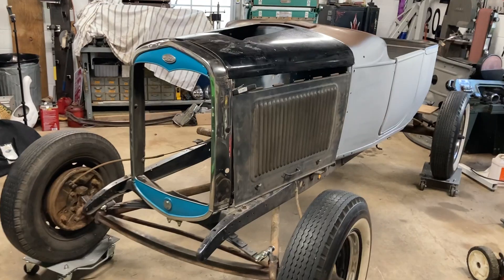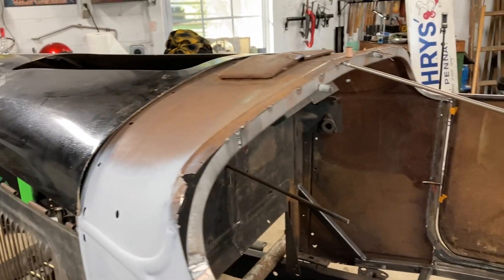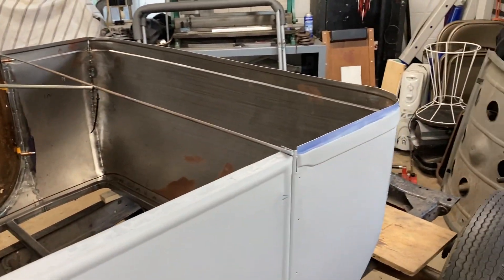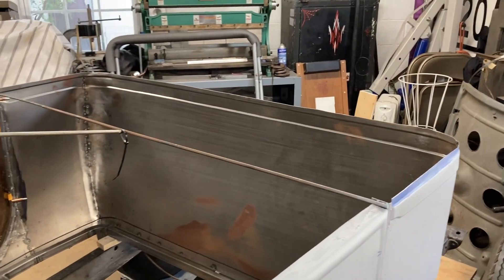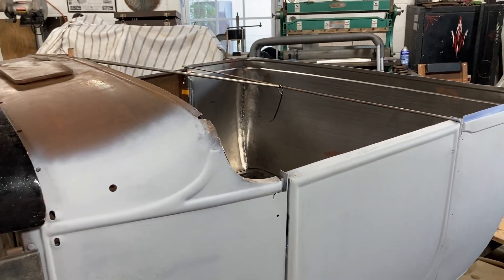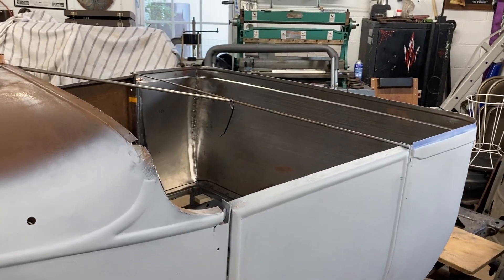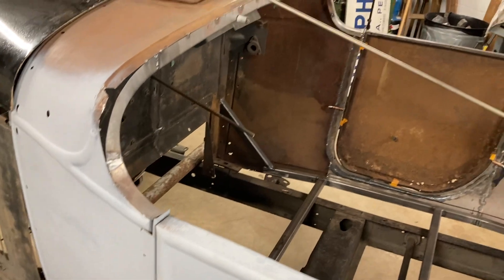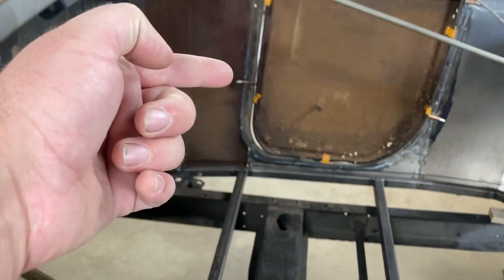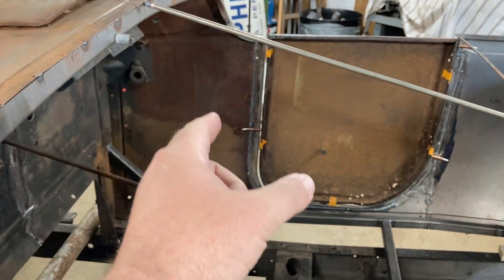It's making sense. I think the next step is to purchase some steel to finish out the back section — much like I did the dash rail up here on the cowl, I want to do a finished area on the top of the back section of the body. I thought about doing a duck tail like you'd see on a T-roadster, but it might be a little too exaggerated for this kind of shaped body. We're going to have a slight arch from left to right but nothing too dramatic. Once I'm satisfied with the A-pillars on the outside of the body, I can go ahead and start the inner structure for the A-pillars — one-inch box tubing continuing up to the connection between the door and the cowl. That'll give me a nice strong point to mount my hinges.